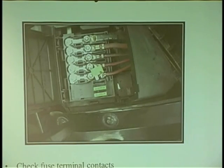and threw it out and put the fuse back in, but they didn't fix the collapsed pin. So at times, it would start, it wouldn't start. So I got there, the car wouldn't start. And all was because someone had spread that terminal. And by you checking across the fuse, especially if it's hooked into the power side, you're checking the fuse is good, so you're going to go elsewhere. So always validate when you take the fuse out.